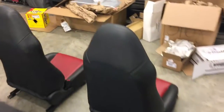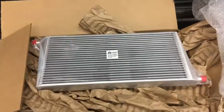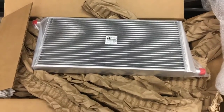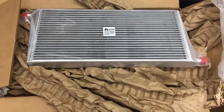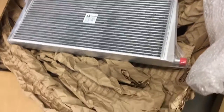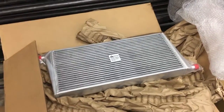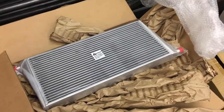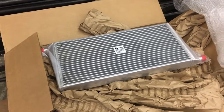Up here at the front, we have our new heat exchanger. This is from Bell in San Antonio — a really nice custom fabricated heat exchanger. We sent them the dimensions that we needed, told them we wanted the dash-12 in and out, and this is what they sent us back. This thing is the size of some intercoolers — probably capable of seven to eight hundred horsepower easily without heat soak, and more than that for a limited period of time.